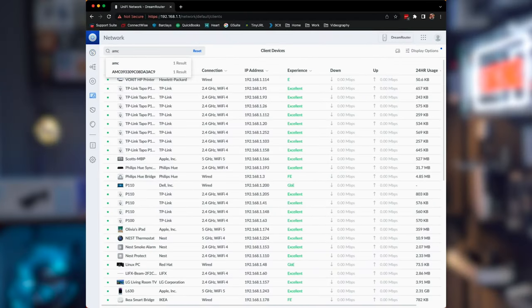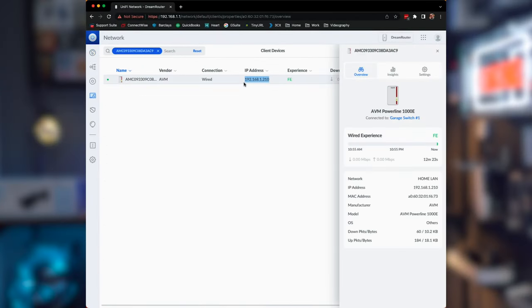If you want to be able to view the camera over a network and thus remotely, there are various steps you will need to take, all of which are explained in detail using the link down below, but in short, the process is this. Find out the camera's local IP address on your network that has been assigned using DHCP. Use this IP to then add the camera in the app, and then you can view it when at home. To remotely view it, you will then need to set up a port forward on your router and a dynamic DNS service to assign a friendly name, as most users' home IP addresses are going to change quite regularly. It's this friendly name you then need to enter into the IP box when adding the camera in the app